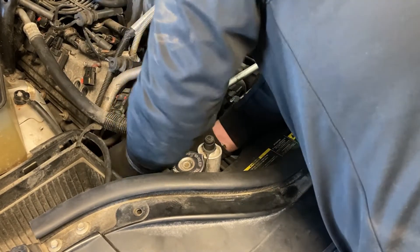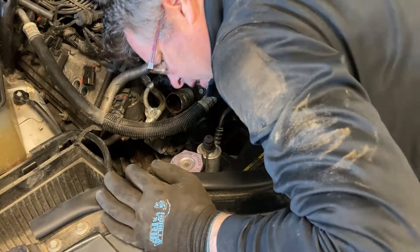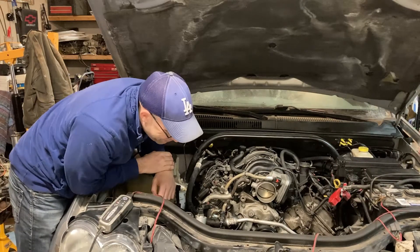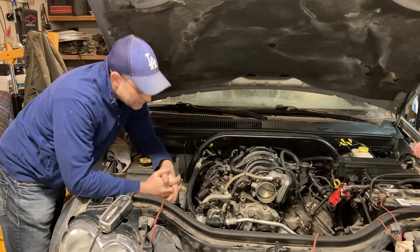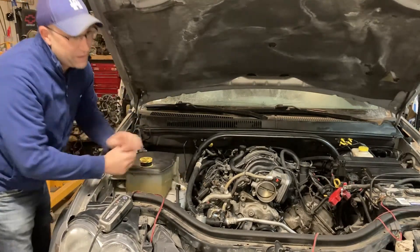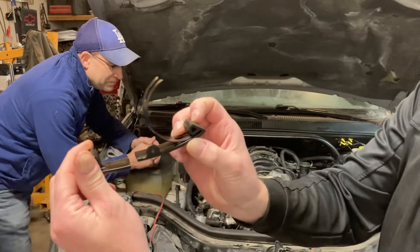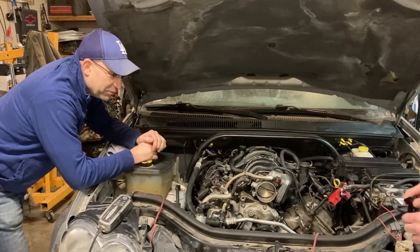Look at that — it can come out. I think it's about time we get this radiator out of the way, so I'm going to work on that next. We got down into the timing cover — we wanted to get into that to see whether or not it was snapped. The tensioner — that's this guy right here — as you can see, it's in two pieces. Apparently it's supposed to be one piece. So it is a common failure on these engines. Well, not common exactly, but when you consider how many millions of these are built, it's common enough.